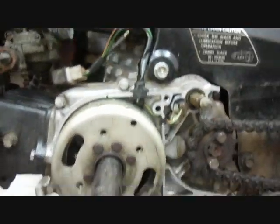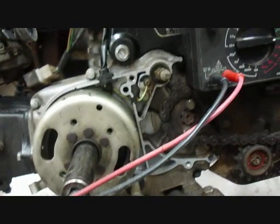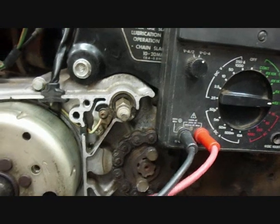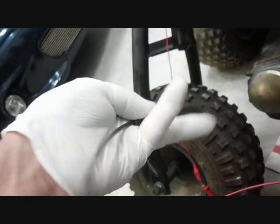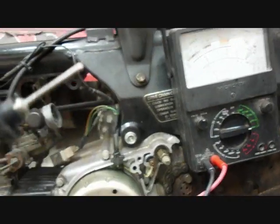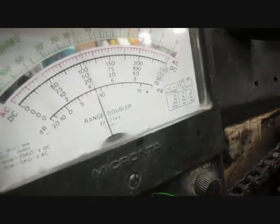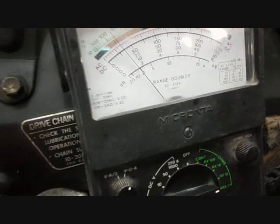So what you do is take your meter and move it to the ohms position. I have a volt-ohm meter — you can probably do this with a digital meter too. Connect one lead to ground and the other lead to the ignition wire. First, touch the two leads together and the meter should zero. It goes almost to zero — it's on about three ohms. There's a little adjustment screw if you want, but it's not necessary. We're just checking for when the points open.